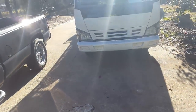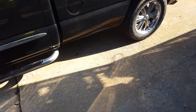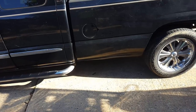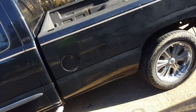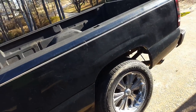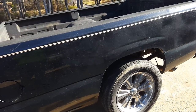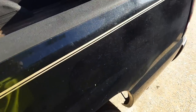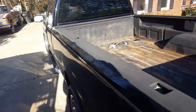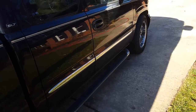When I bought one of these I should have bought a long time ago, I stopped working in it. It had about 215,000 miles on it and never really had any engine problems. I tore up my rear end a couple times, but the last time I upgraded to a 4.11 gear with the Auburn locking rear end, and that kept it from tearing up again.